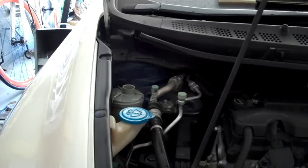I'm going to go ahead and put the car in the air and start getting to this power steering pump. With the car in the air, light in place, and supported on a jack stand — if you're going to do the water pump anyway, you need to take off the motor mount on the left side so you can drop the engine down and get to that tensioner bolt. I'm also removing this plastic liner in here to get more access into that area. This is a pretty tight area to work in, so any extra access you can get is going to help you.